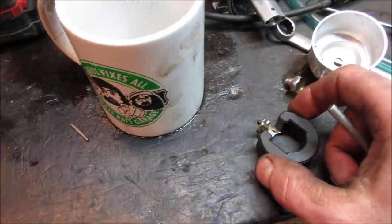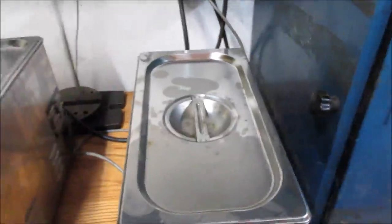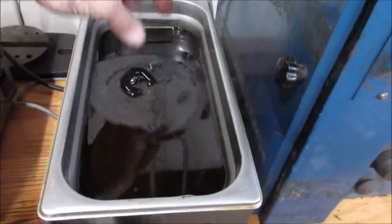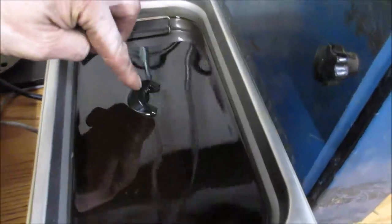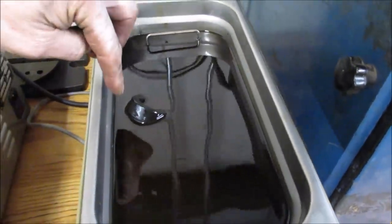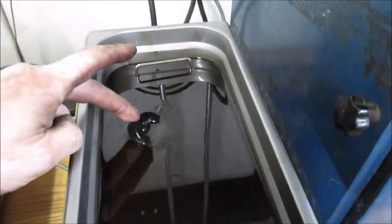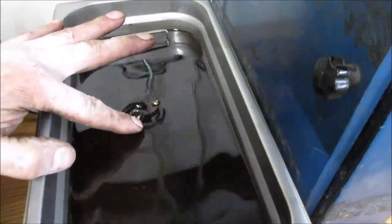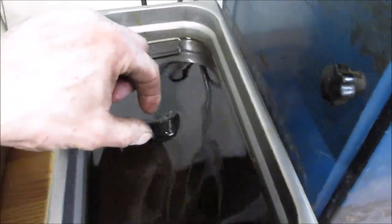I'm also going to go throw the float in the cleaner and make sure it floats, because that would do the same thing. So, does your float float? Looks okay. The weight of the needle is still on it, so it wants to flip it over that other direction. But if that thing went so you could barely even see it, if it was hanging out like something like that, where it's just on the verge or it sinks, then you know it's screwed.